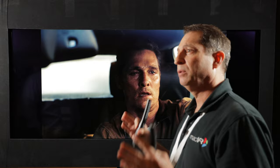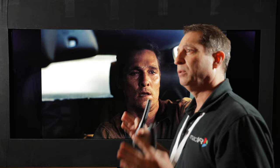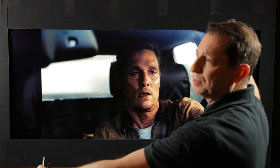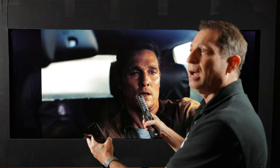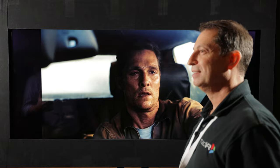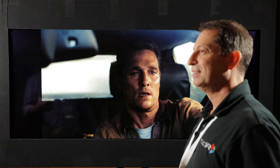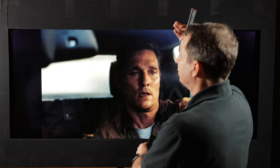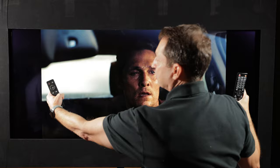Whether you're watching an Apple TV with a 16x9 user interface and you play a scope movie — now it goes wide. You have to zoom the projector to fill that. And then when you go back to the 16x9 Apple TV menu, your content is on the ceiling and on the floor. One of the key benefits of the Envy's aspect ratio control is it delivers constant image height — the height is always the same, whether it's on a 16x9 frame or widescreen scope. You've got the edge of our masking screen and the black bars on each side, as you'd expect with 16x9 content on a scoped screen.